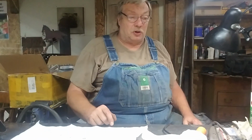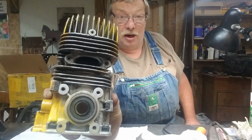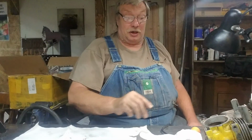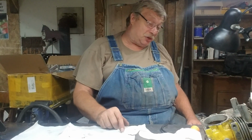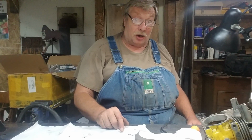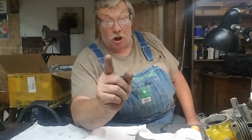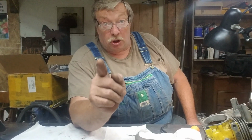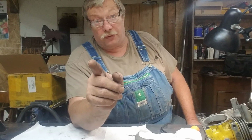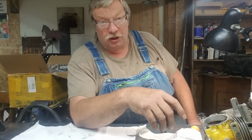Okay, you seen the crazy things we're doing to this exhaust. Yeah, that's big mouth, ain't it? You gotta get it out if you want to get it in. And believe me, with 6 ports delivering air fuel mixture off of reeds out of the case, we're getting plenty of air. The only thing I have to do is correct numbers. McCulloch has always been pretty good about the numbers on their transfers. The only thing that I have been concerned with is they use too many ribs sometimes entering them transfers, and I cut part of them right off. Just boom, do it.